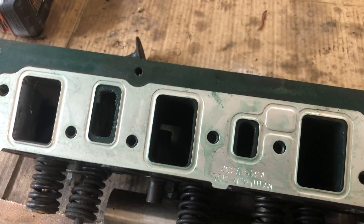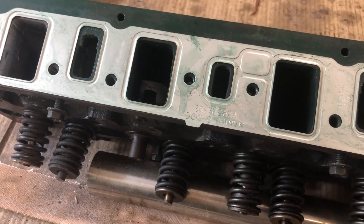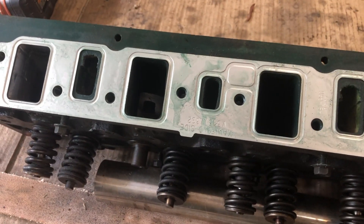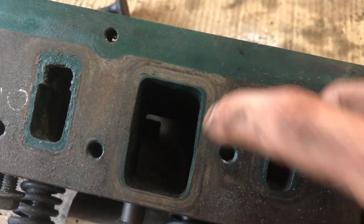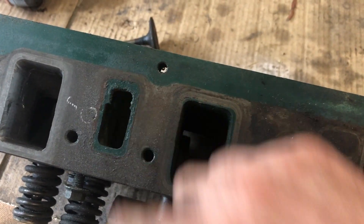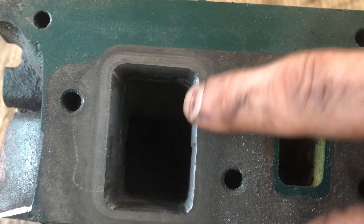What I did is I just took some spray paint and ran it across the manifolds — I just cleaned this with carburetor cleaner to get the paint off. Don't do that on a fresh head; this is going to go to the machine shop and be dropped in a vat of boiling whatever, so I don't care about it being covered in paint. What you'll do is take the intake manifold gasket, gently bolt it down, get all those lined up really good, and spray the paint on it. When we look in here, you can see these little green edges — these are the parts of the cast iron that are interfering. As the air passes through, it actually hits this, ricochets off, and creates turbulence. Those are the water holes for the antifreeze — we don't care about those. Over here you can see where I've already been grinding just enough to make that green paint disappear. That's what you call gasket matching.